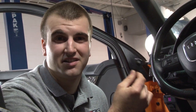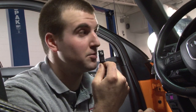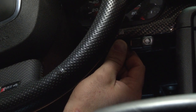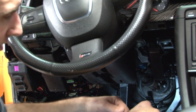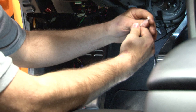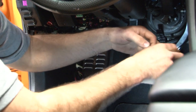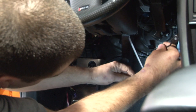This is the last part of the installation. You've got about four feet to move the power control button wherever you would like. In our case, we're going to mount ours right up here behind the ignition key. Since we're mounting our switch right behind the ignition key, we're going to have a lot of extra wire, and this is where your zip ties come in. Just coil it up and take a zip tie and wrap it around — that way you get a clean installation. Then take your second zip tie and mount it on a firm item.